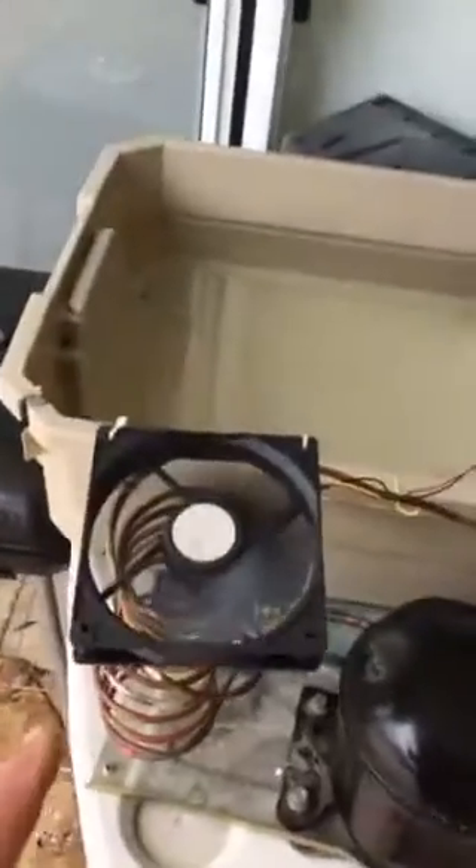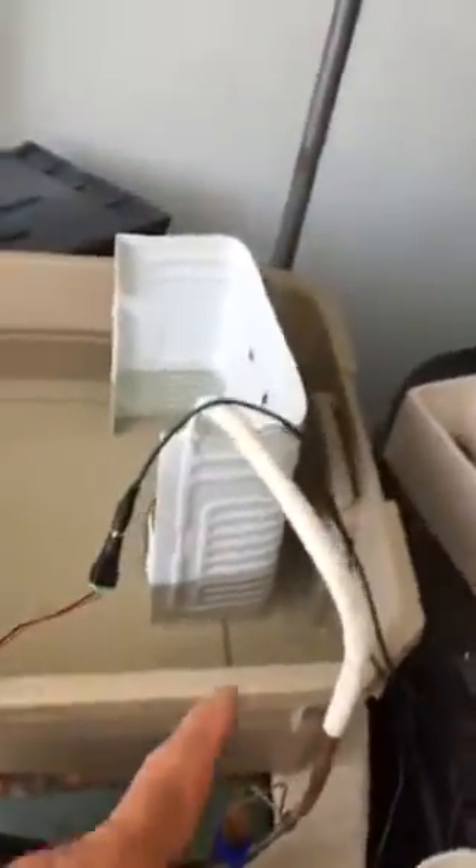So what I did was I got this little refrigerator, took it apart, had a friend fix it up so it would work. I hooked up this 12-volt fan, which I'm going to have powered by the 12-volt system that's running the pump. The rest is regular 110-volt voltage, which I'm going to have housed in a box. This line here — picture it inside the blue tank, which by the way I got a new tank so it'll probably be a red tank. I've filled it up with water and I have it running here. This whole thing will be submerged in the water.